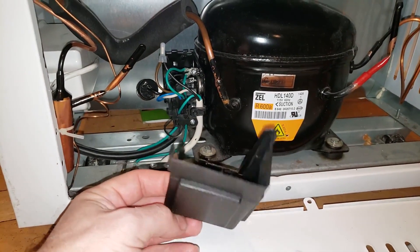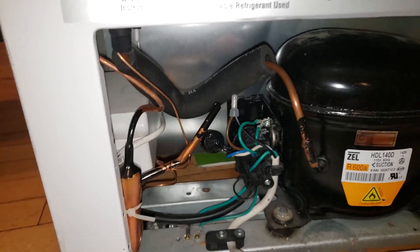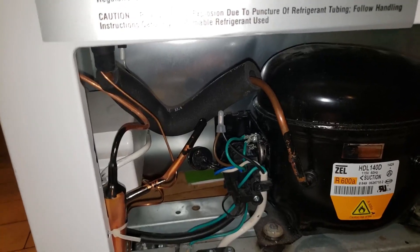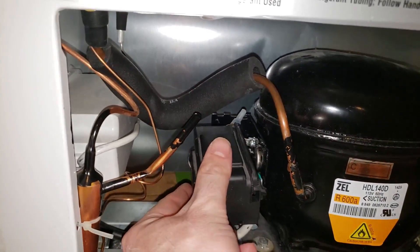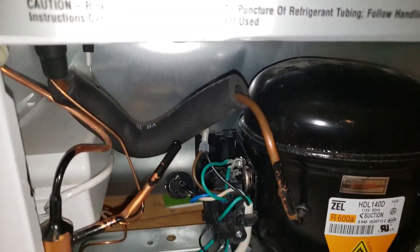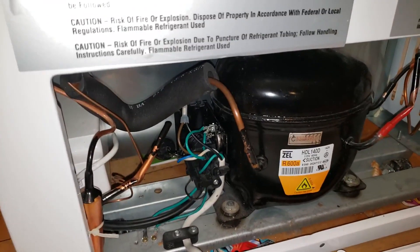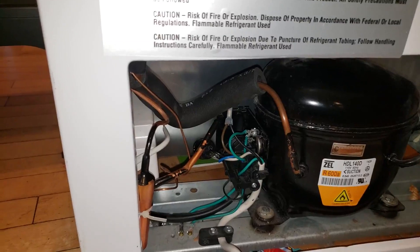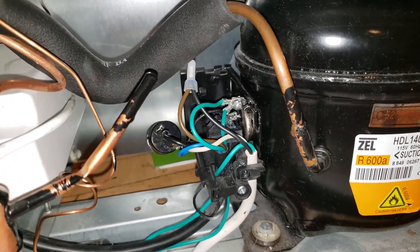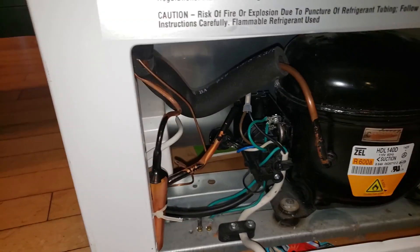I feel good about this - it's great, you can hear the compressor is on again. I didn't lose all the food. Keep in mind when you open this thing up there will be a cover on this stuff. Whether I put the cover back on or not, probably not, because it's all behind the other panel. But if it doesn't look the same and you're wondering how I got into that stuff, it's because there was originally a cover on everything. Once you remove it you'll see where your starter relay and all that is. In case you're experiencing the symptoms I described - clicking, nothing getting cold, compressor warm but not kicking on - you can hear the nice hum of it now.